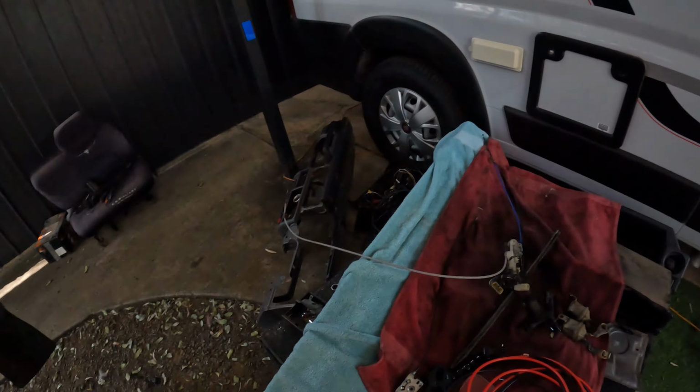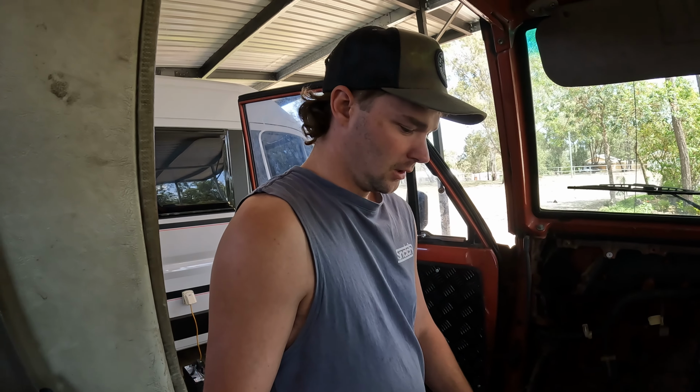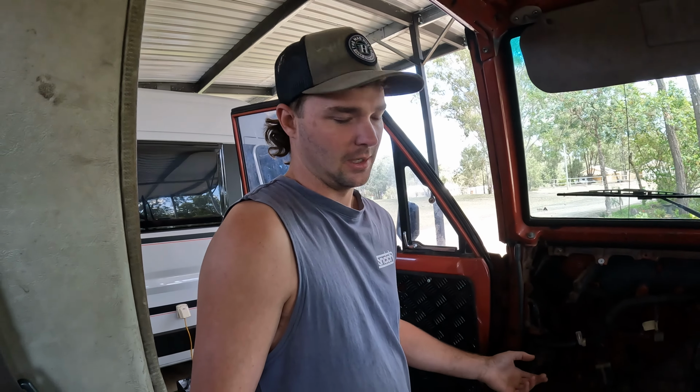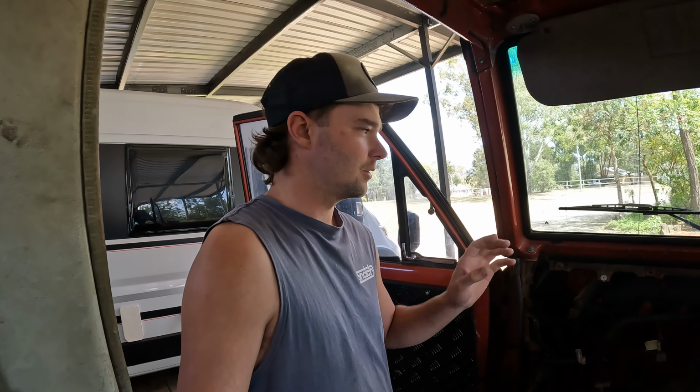We went and seen the auto electrician, and he has given us some new wiring. So that will be our glow plug wires soon. Now, the benefit of actually pulling the glow plug wires out of this whole harness now is that if there's another problem, I'm just going to have it taped in patches to the main harness, so it's easier to replace next time if I do have this same problem. But yeah, I'll just keep going through tidying up all the wire, then we're going to feed it back into the engine bay and start putting the dash back together. So yeah.